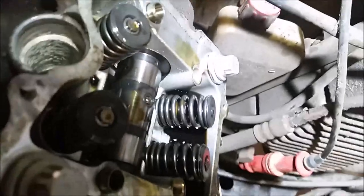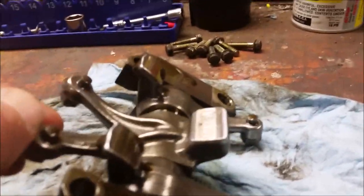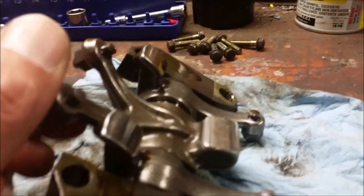I pulled three of the bolts off just to speed things up a bit, but now we get to see what the real damage looks like. You can kind of see how much wear I've got going on there. The cam lobe is pretty well gone. Here's a better shot under a decent light — see how that's worn right here? There's a pretty good groove there. That's telling me the exhaust valves were not opening correctly.